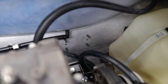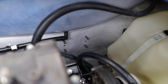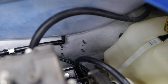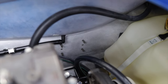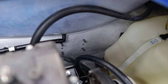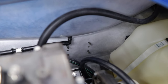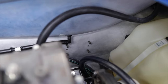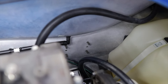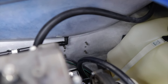To start installing the intercooler itself, we're going to have to bolt up the bracket. The bracket secures to where the factory airbox bracket was, and we'll be replacing that with an aluminum bracket for the intercooler. We will still be utilizing the four studs on the side of the ski, however it is going to come with new nuts and new washers. We'll also have to temporarily disconnect the footwell drain to get the bracket on there, then reconnect it afterwards. After that, we can go ahead and put the exhaust manifold back in before installing the intercooler itself.